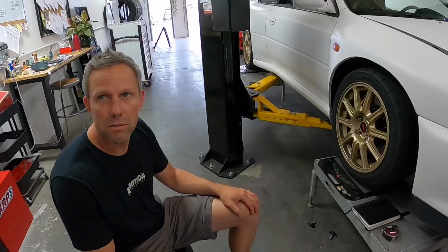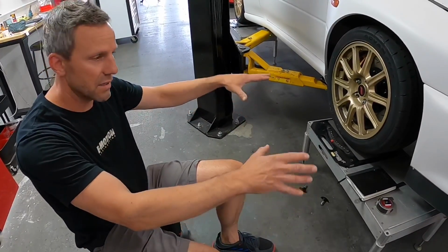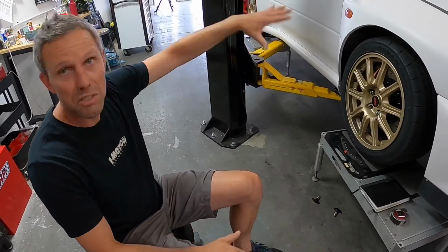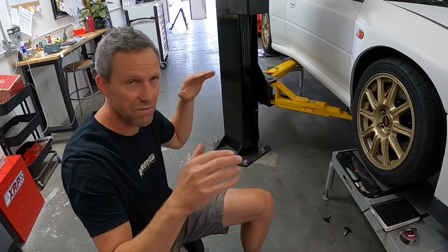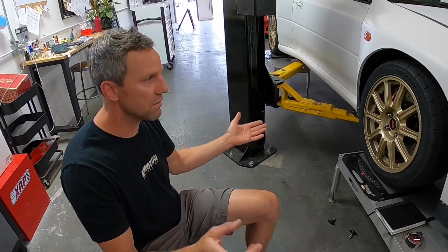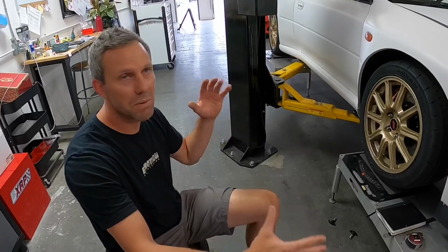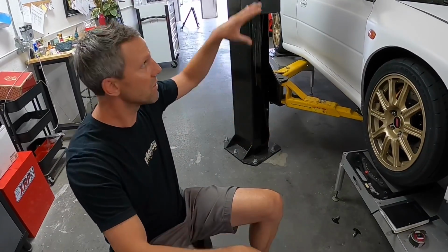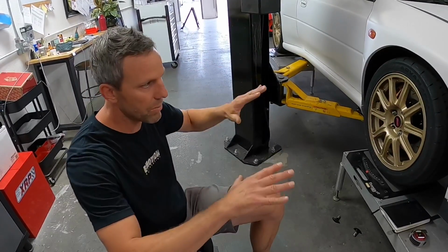All right, so it's time to get started. We leveled the platforms, leveled to themselves and to each other, so it's a perfectly level table. We adjusted the tire pressures so they're where we need them, because that's the basics, fundamentals. If you start wrong, it's gonna be wrong. So now we're gonna start the measurement process of measuring the camber and the ride height, because you must corner balance the car as it would sit on level ground with the driver in the seat and the tire pressures, everything just all perfect.